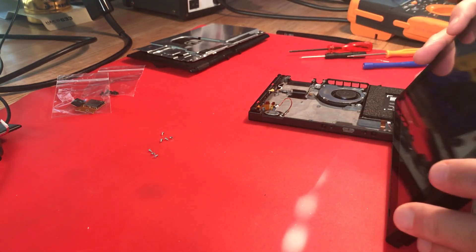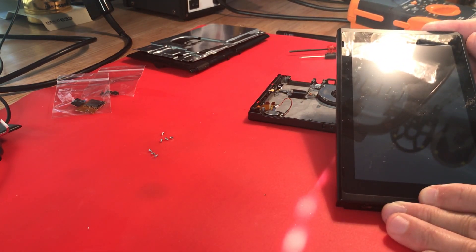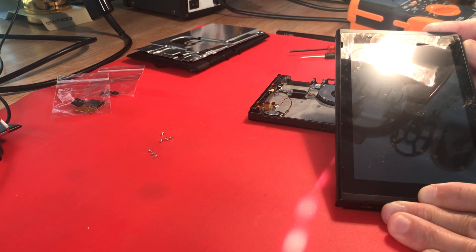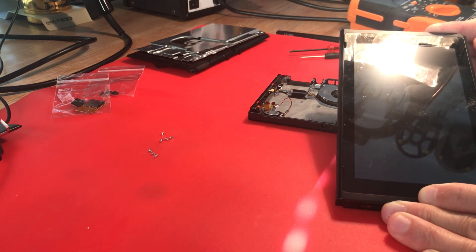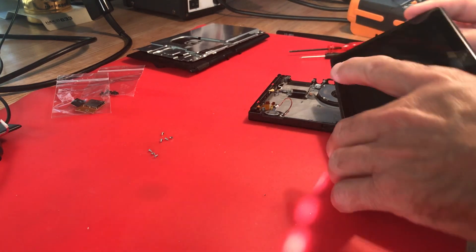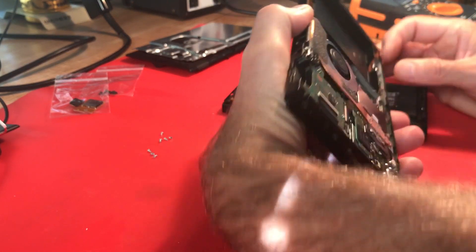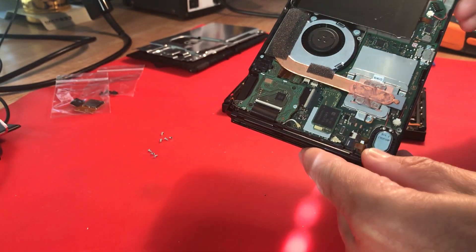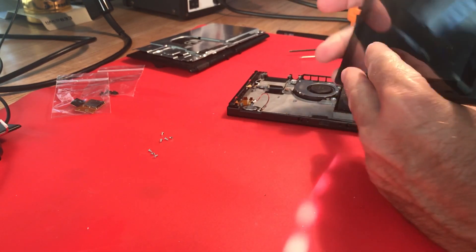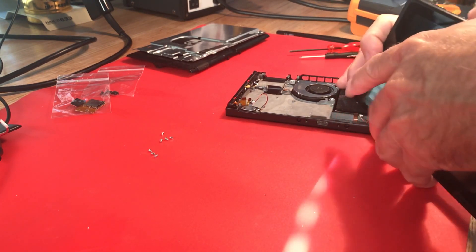I've connected it. Let's see what we have. It does not power on. This may not be just a bad charge port. Oh, it came undone - it came undone. Don't give up hope yet. You know what, this battery connector is damaged. It looks like the latches are damaged on the side of it. It doesn't stay very well.